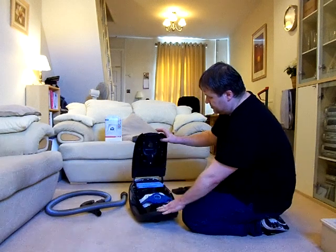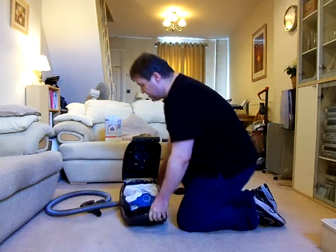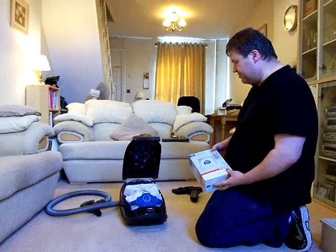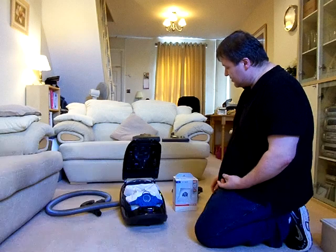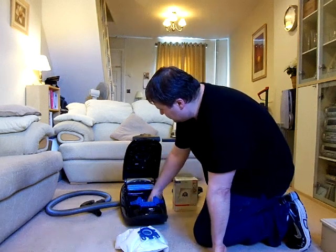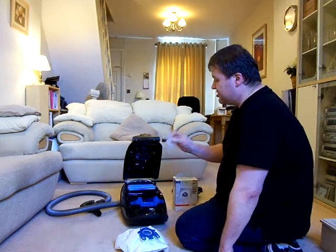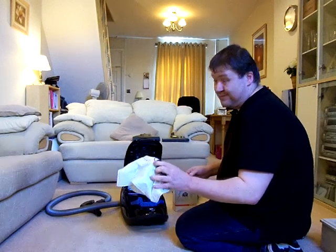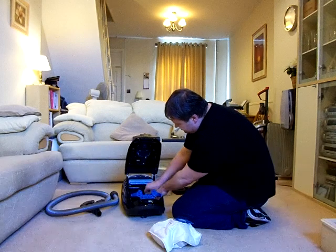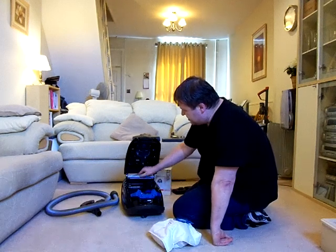Inside, when you open the top, this machine uses the GN type bags with the blue collar. They come in boxes — Miele high clean bags — and it's a nine-layer filtration system on these bags, which means what goes in stays in and you don't get dust leaking through like you do on cheaper bags. Throughout the life of the cleaner this compartment will stay relatively clean. You've also got the back pre-motor filter, which is there in case the bag ever bursts, though I doubt it ever will because they are fantastic quality. The machine has full HEPA filtration, and it's easy to change — just remove it.